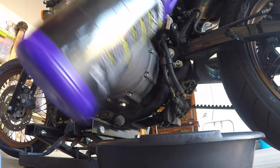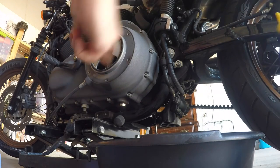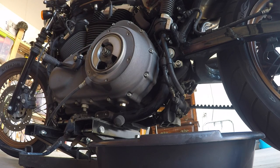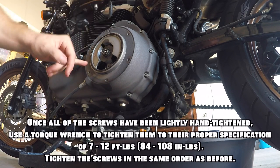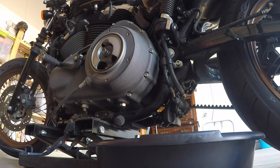Now that I have one full quart of gear oil inside my gearbox, I'm going to start putting everything back together. Make sure you still have the spring. All you have to do is put everything back together and then get a torque wrench and torque it down to 90 to 120 inch-pounds on each one of these. So it's pretty simple — I'm going to torque it down once I have it on level ground. That's basically it.